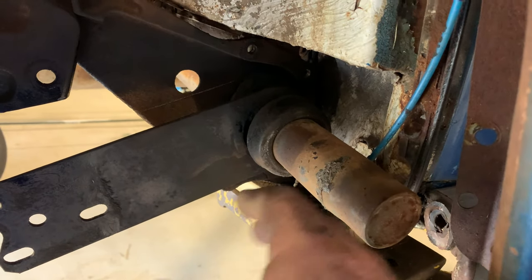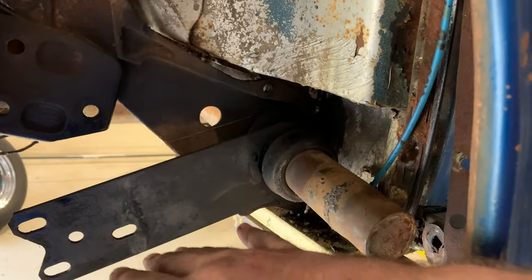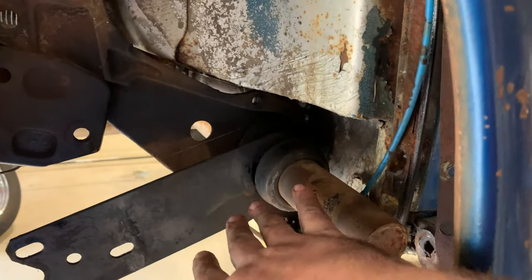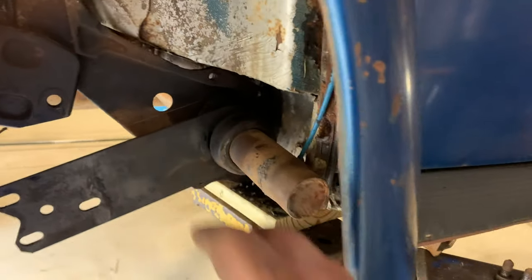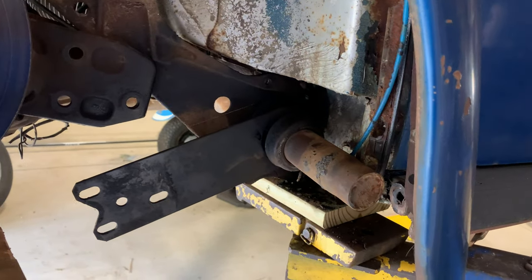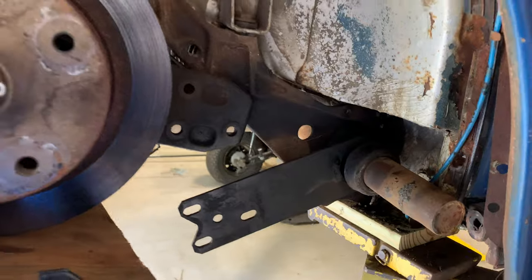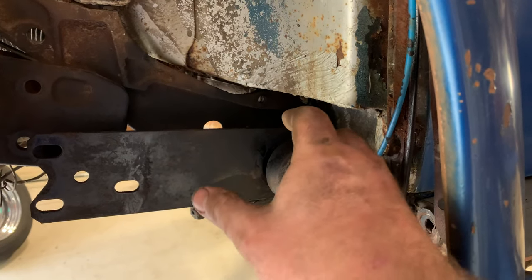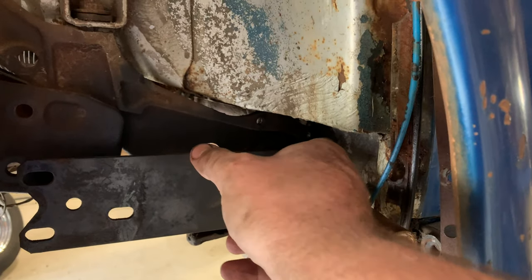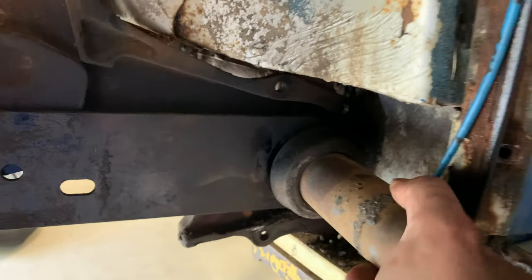I'm going to do three outer splines up. So instead of it pushing the car down, it'll actually be letting the car settle down a little bit more — I'm going to go three outer splines this way. That should give us right at seven inches of travel more, so it'll go down farther and allow the wheel to go higher. Then I'm going to have the air shocks to adjust it wherever I want. So you pull it out, run it up one notch and drop it in, pull it up, run another notch, drop it in — same thing. I went up three notches, then this can be pushed back into place.